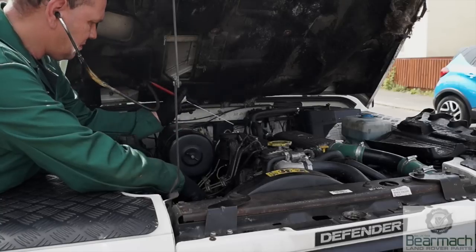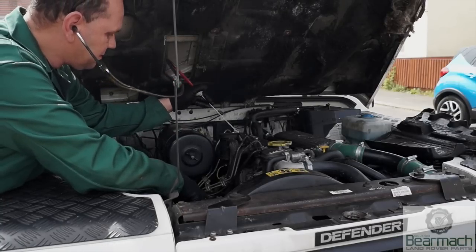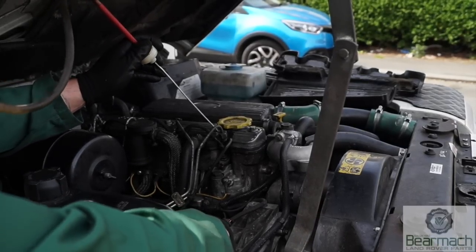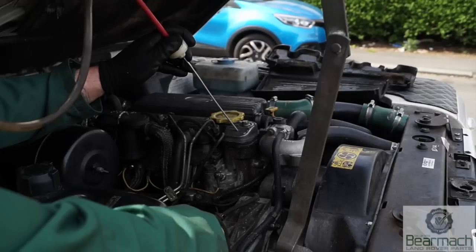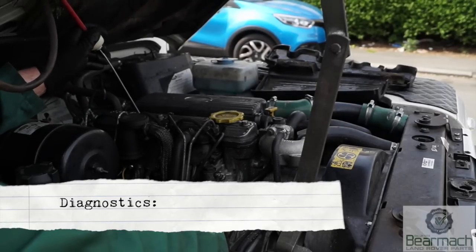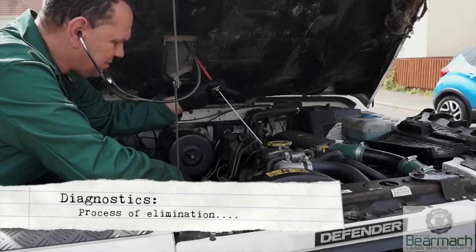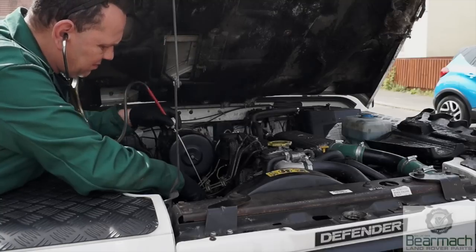This is a bit of educated guessing first of all, because you've got to find roughly where the origin of the noise might be before you can go in and isolate it a bit better. I'm thinking it might be the tappets are loose. I'm putting the rod on top of or above where the rockers might well be. The process of diagnostics is more about a process of elimination — find the stuff that's good, cross it off the list, and move on to where you find the problem, rather than just guessing and pulling things to bits.